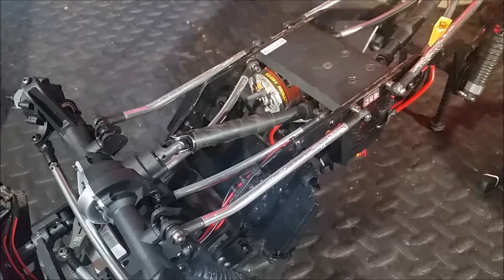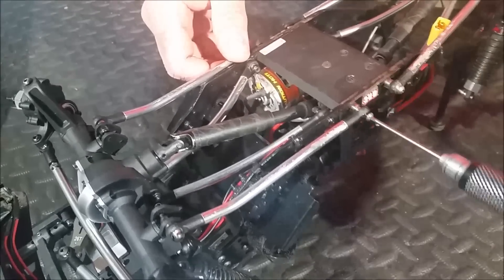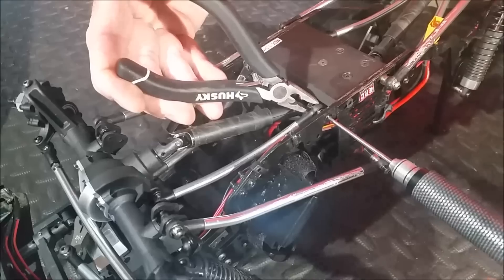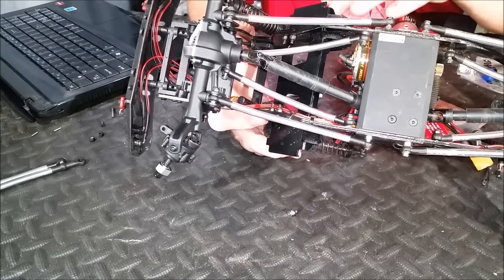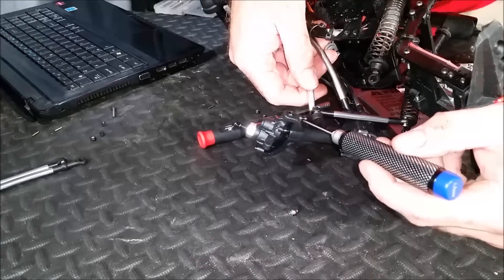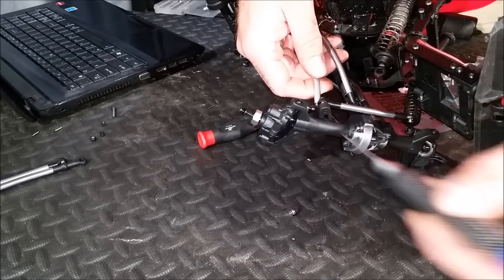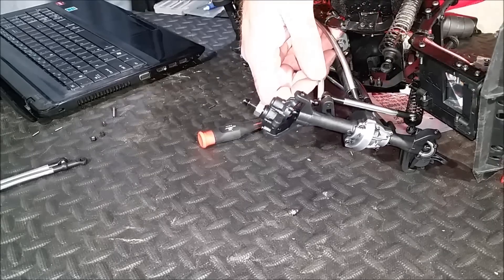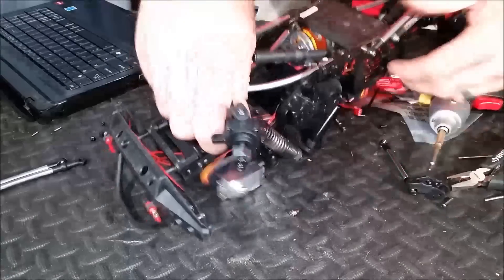Now we can take this other link and mount it right through the upper hole in the axle housing, put our nut on the backside and snug it up. Then pop off the passenger side lower link so we can get to the mounting hardware of the upper link to remove it. With that out of the way, pop this upper link off — don't forget to put your lower link back on. Now we can go ahead and put the shocks on. The ball that the shock mounts to is so close to this mount that I can't fit the shock eyelet through to get it installed, so I have to remove this mount, install the shock, and then put the mount back on. Once that's off, the shock eyelet goes on and then the mount can be reinstalled.